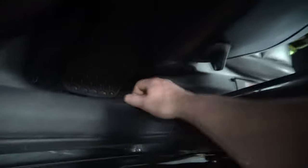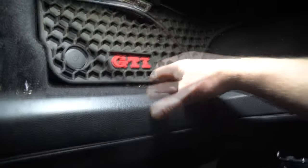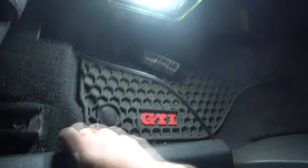We're going to have to pop this up. This just comes out from behind the seat and gets a little pried up. We need to loosen this trim panel from right here. After we do that, we're going to come over to the front — you're going to see it comes up once again, just like this around this one. Just grab it and it just pops off, and this just slips out around here.